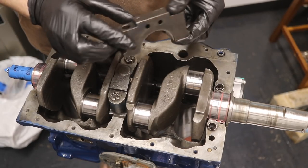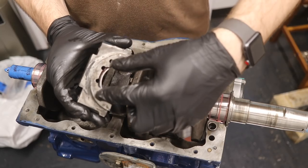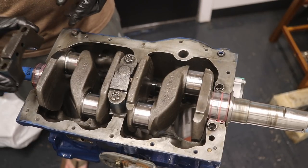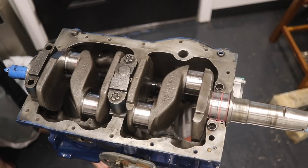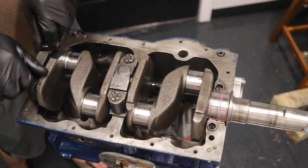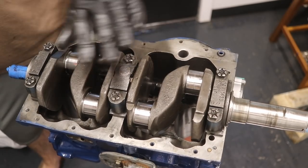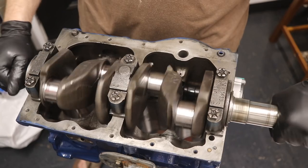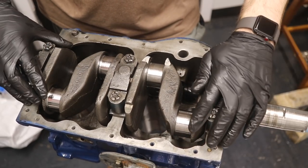Now, just like the other bearing, press it in — these only go in a certain way. This side has two holes used for tightening down the timing-side cover. Press it down, take a rubber mallet, pop it into place, then run the two bolts down hand tight, and repeat for the last end cap. At this point, with everything hand tight, make sure your crankshaft spins freely without any binding or hooking. If it does bind, you need to bring it to the machine shop because your line bore might be off or there could be other problems.